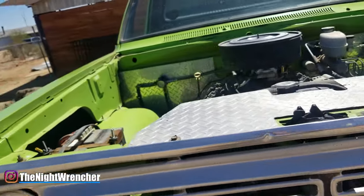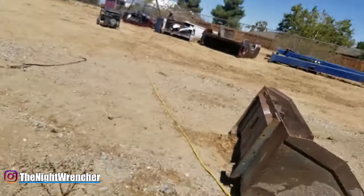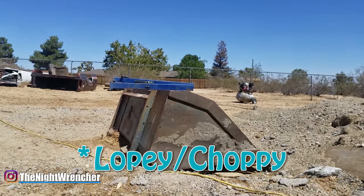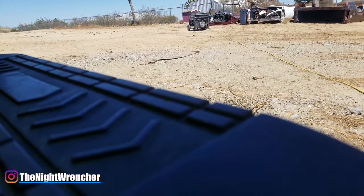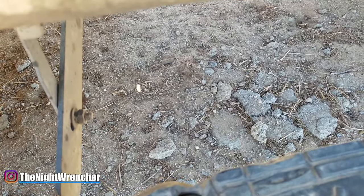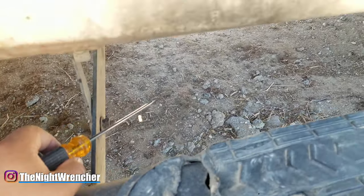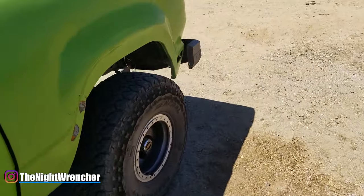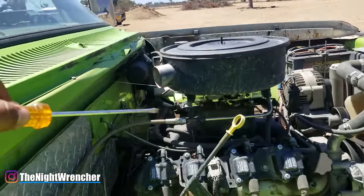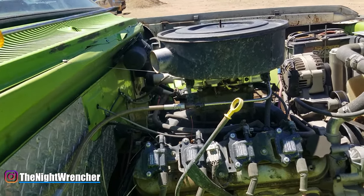Right now I've got it at one and three quarters of a turn out. It's definitely running rich. I'm going to try to let you guys see if you can hear the exhaust. So a couple things — you guys might be able to tell by the video that it's smoking a little bit. But the idle kind of sounds like if it had a lopey cam — the exhaust note becomes really, really deep and kind of hollow. Kind of not throaty, not crisp, but kind of like a deep, hollow, old-school muscle car sound. That's how you know you're running rich.